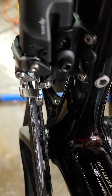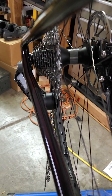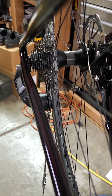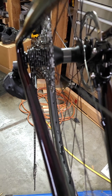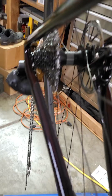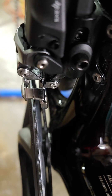And apparently this is only an issue when the rear derailleur is in the largest cog. I'm not sure what SRAM has going on. We know the derailleurs talk to each other and can make some gear-shift behavior decisions based on what gear you're in. So let's shift up into the highest gear — the smallest cog in the rear — and watch our shifting behavior once again.